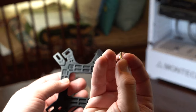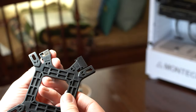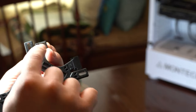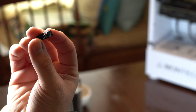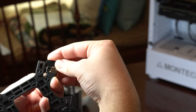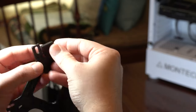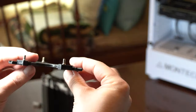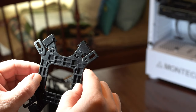So you take these little flat screws and put them in the correct position so that they click in there. Depending on whichever CPU you have, either it goes in the far right position or the left position — in my case it's the right. Then you take these little pieces and hold the screw and click it into place. You want to do that for all four of the bracket screws. Once you have all four screws, you can see they're stuck in place now, so you are ready to move on to the next step.